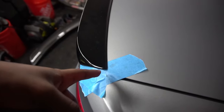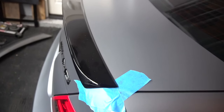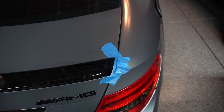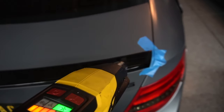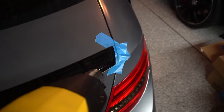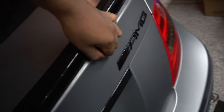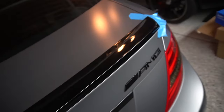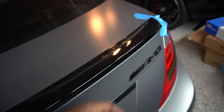As you can see there was a tiny gap between the stock spoiler and the actual paint itself, so I just slid the fishing line down in between — that should help a lot with taking the spoiler off. Just make sure the tape is coming off nice and easy without scratching the paint. I put some tape in the corner where I'm grabbing the spoiler, then I'm heating up the entire spoiler — not going too close, just enough to heat the material up so the adhesive below warms up. I noticed the side where the AMG badge is already pretty loose. The spoiler is warm enough now; I'm lifting it up a little bit and if I pull more it's slowly coming off, which is a good sign. I'm going to get some fishing line and simply floss through — just like you floss your teeth, floss the spoiler off. It'll cut the existing tape out of the way and we can make more progress.